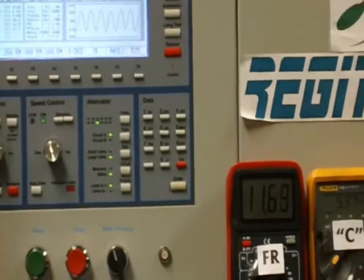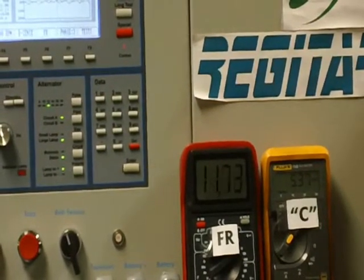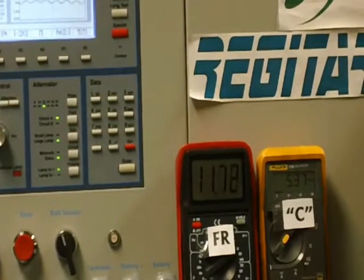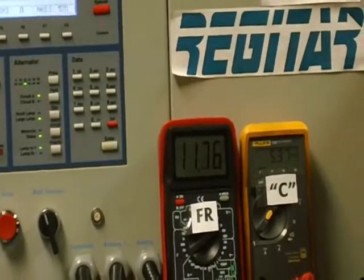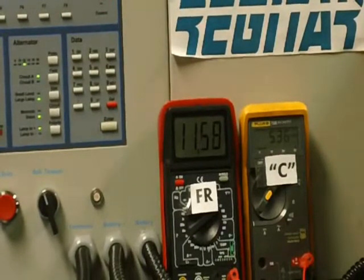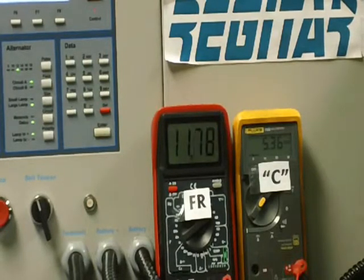What happens is on this Honda dual mode charging system is the dual mode system actually operates with a bunch of different sensors giving information to the ECM. The main sensor is the ELD, or electronic load detector module. As you saw in one of our earlier screens when we showed you the schematic of the dual mode system, you saw the ELD shown in the schematic which is connected to the PCM. The PCM looks at the ELD, the compressor clutch switch, and other different loads and sensors to determine which mode the alternator will be in.